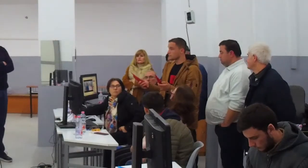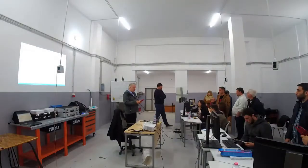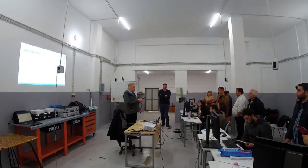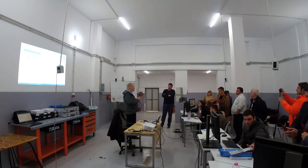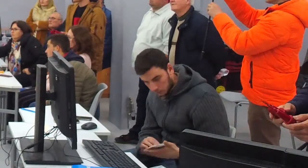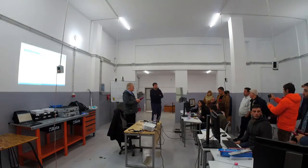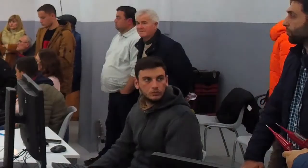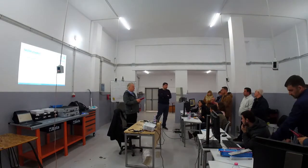So how exactly we are going to use this instrument, I will show you when we have a car here to show. So why are we doing this? We first have to know that this instrument, where we want to do the measurement, if the high voltage is deactivated, is working quite well. Before you start working on the car, to verify that the car has the voltage disconnected or not, you will test whether this instrument works.